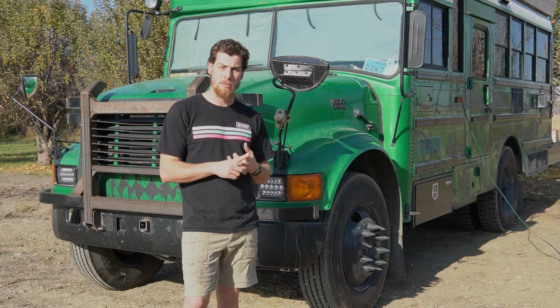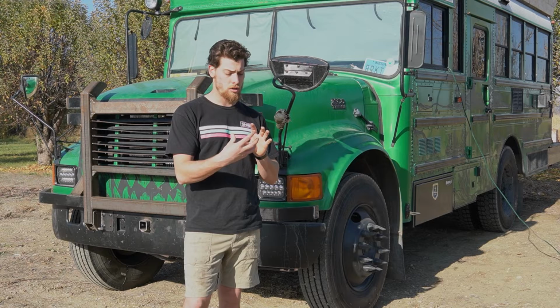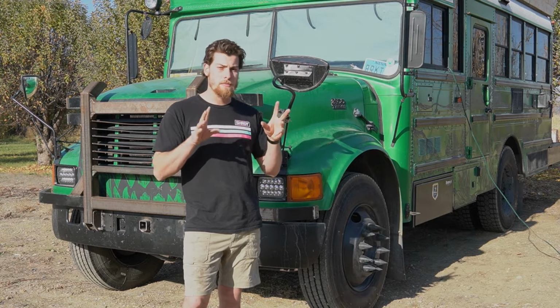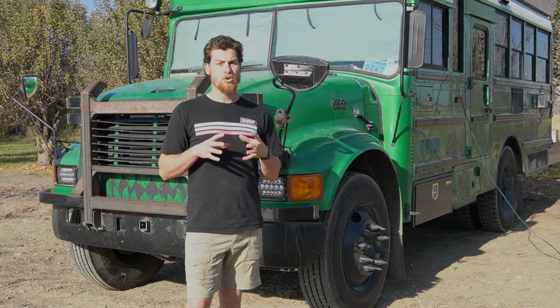You can drop the oil pan and replace the entire seal on the back side of it and the front side, and do a more proper way of a fix, so you're buying a whole new part.